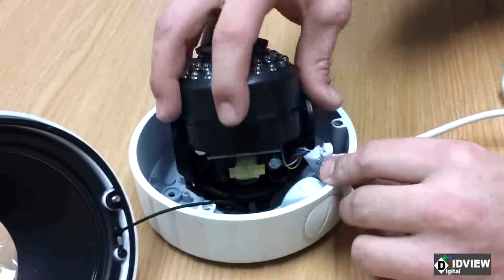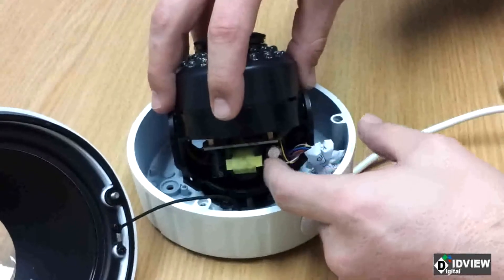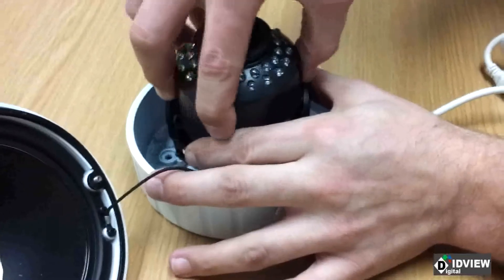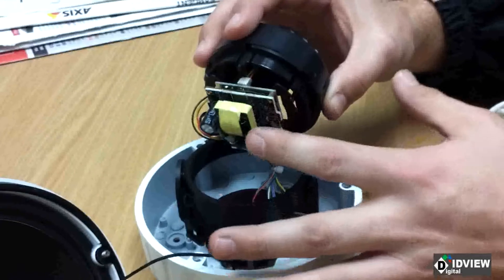The first issue is the capacitor — every now and then when moved a lot it can get bent down a little bit and get caught on the bottom plastic harness. If that happens, as opposed to going across town to replace the camera, you simply pull it out and push the capacitor back up. It won't break it.